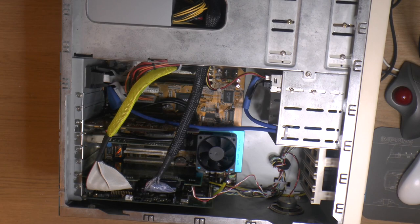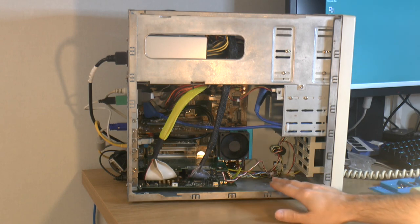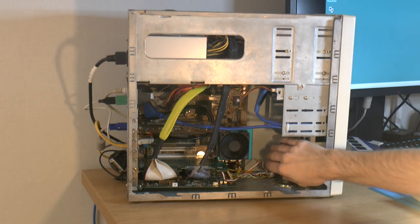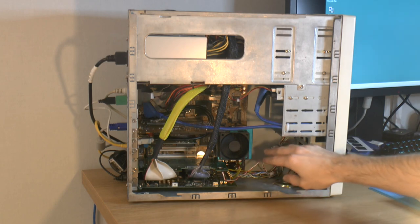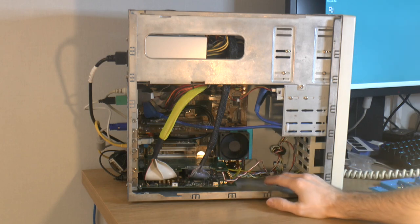Probably time to reinstall the OS and do some benchmarking. We are up and running. I did some measurements on the VRM with the new heatsinks — on my open test bench without a fan, I was at 72.4°C. With the new heatsinks it was about 62.8°C, so about a 10-degree drop. I've now measured with the 80mm front fan running at about 2000-2600RPM and we're at about 49°C on the heatsinks — a very good improvement over stock.